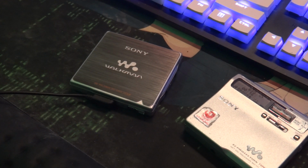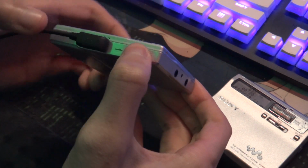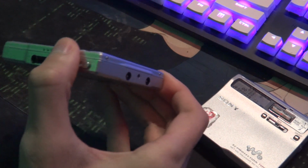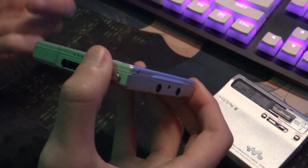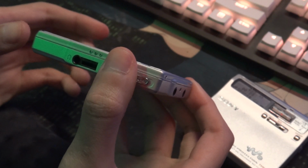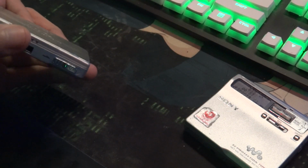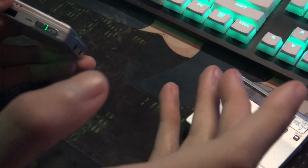Hey everybody, in this little short video, I want to go through how to somewhat repair a mini disc player that has problems with the spindle getting stuck. You'll know because you'll get a read error, and if you listen to the player, you can hear the disc is not spinning, but you can hear the laser trying to focus. If you're running into that, where you can tell the disc is just not spinning, it happens sometimes, or it's happening all the time.